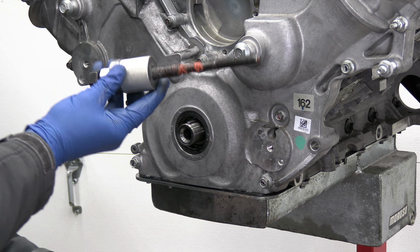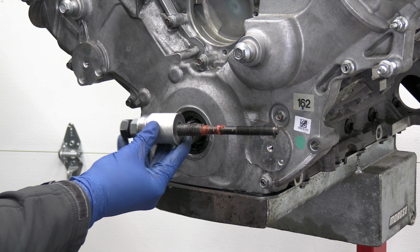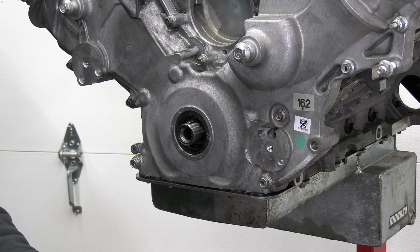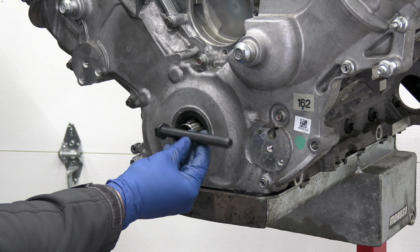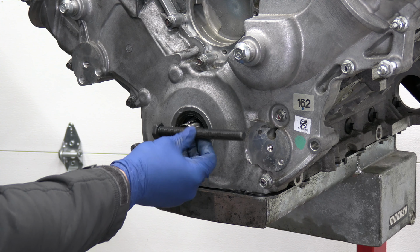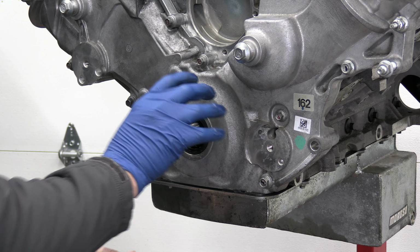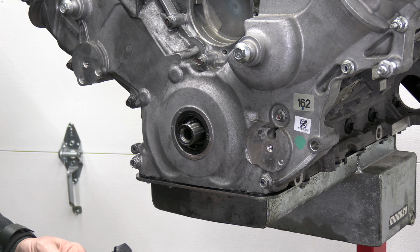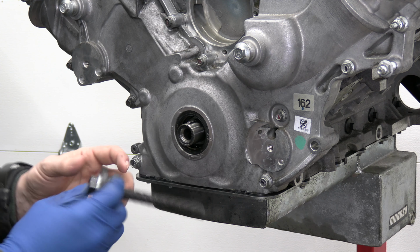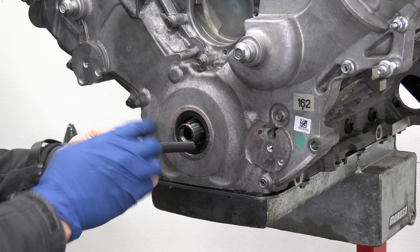And typically, when you install one of these guys, you wanna use a harmonic balancer installation tool like this one. But they don't sell anything for the Predator, because the Predator thread inside the snout is a metric 14. So I had to do some searching on the internet, and I found a metric 14 by 1.5 and 140 millimeters long. So I'll put a link in the description for any of the Predator guys looking. But I'll basically put the hub on. I'll use this formed washer that will go with the hub, and then I'll have a washer on top of it. And I'll just go like this. And then I'm going to put ARP fastener lube all over this thing. So all I have to do is tighten it down like so.